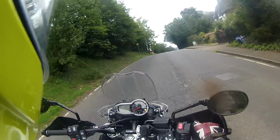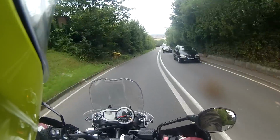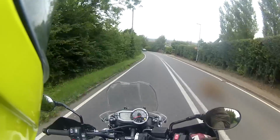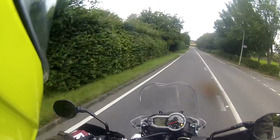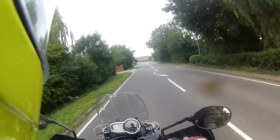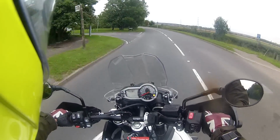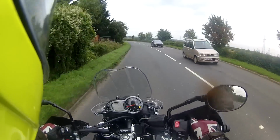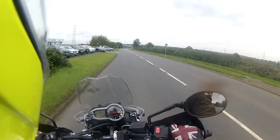And then the XCA and the XRT, i.e. the top models, and the T for toys, as you know, adds another auxiliary socket. So I've got 2 auxiliary sockets down here, 1 here, so I've got 3 cigarette lighters, essentially. And now because of that, plus the heated seats and the fog lights, the XCA and the XRT, the top of the range models, come with a bigger alternator, so a 650 watt alternator, I believe. I'll look it up, and if I'm wrong, I'll put the actual figure up on the screen. So yeah, it's all good.